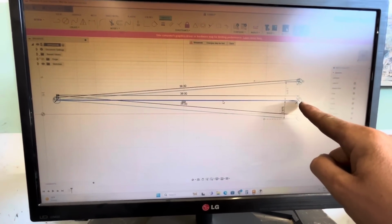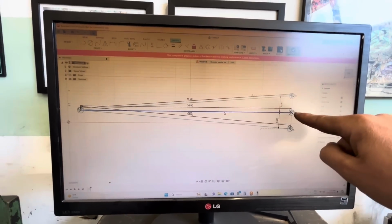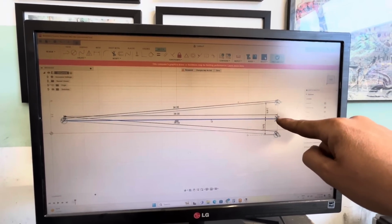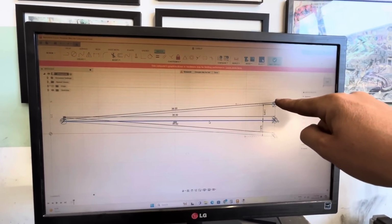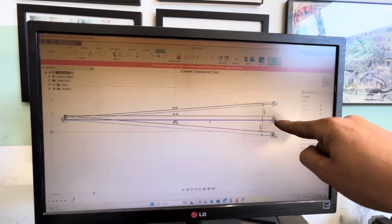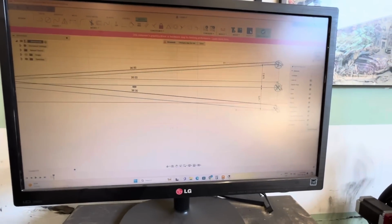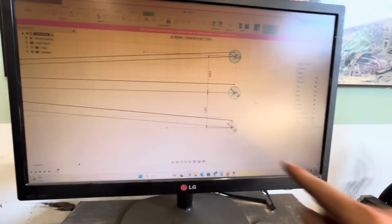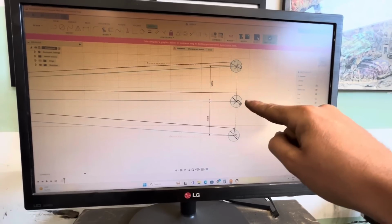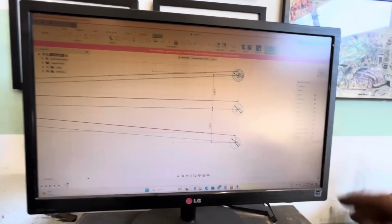Our airbags have just under 6 inches in total travel. So if we're straight across at our 3-inch point and we drop the airbags, the panhard bar is gonna raise up 3 inches. We fill it back up to ride height, down 3 inches. We go fully maxed out, 3 inches that way. So when it's in the middle, that's gonna be its longest spot this way. And when we air out, and it goes up, we're gonna be at our shortest point this way.